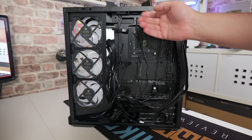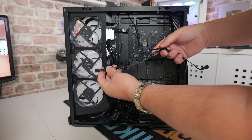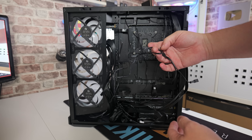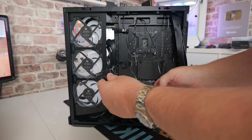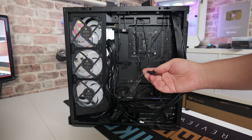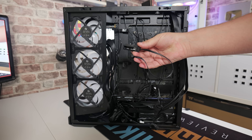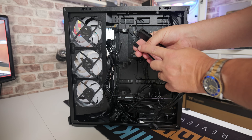The cables are now passed through from the back — one from each fan. What you want to do is daisy chain all the cables together, so you've got the one that plugs into the motherboard at one side and the others daisy chained together. They just push together on the pass-through — do that for all three fans, and also do the same for the addressable RGB, having the female plug at the end. Make sure the last one on the chain has the plastic cover over it to prevent any short circuits, or you can connect it up to other devices if needed. You can also use the included fan hub splitter, but it's a little bit pointless and just adds more bulk. If you do use it, plug each fan into the ports on the hub and then plug it into the CPU fan header.